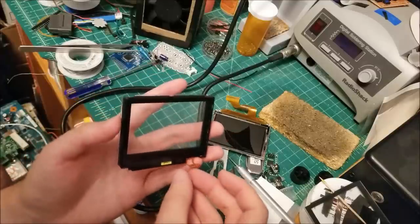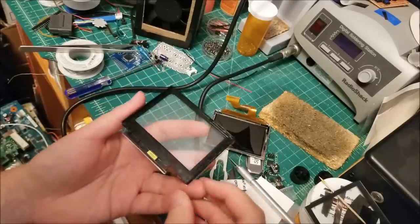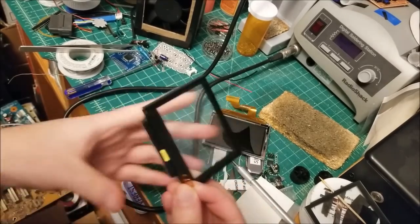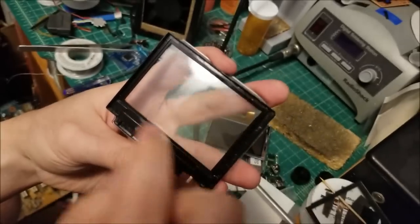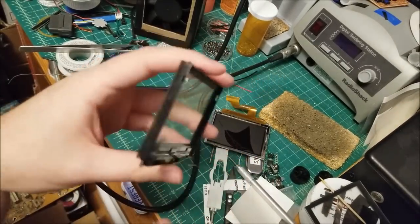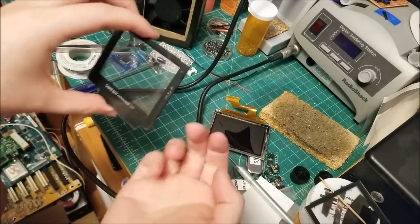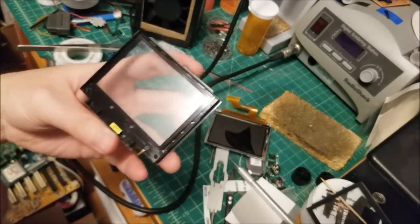And the Game Boy has to boost up the voltage to probably about 12 volts or something to drive them all at once. So basically, it's just a lot of LEDs along the bottom. It shines light upwards. And if you've ever looked very closely, there's a bunch of horizontal lines all through the front light. When the light hits that perpendicular, it actually gets scattered to the back. Then it bounces off the screen and comes through the front. And that's how you get your front light, basically.